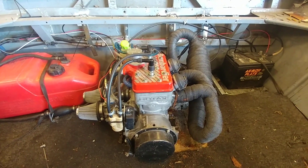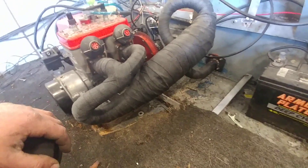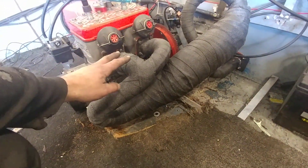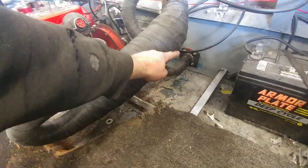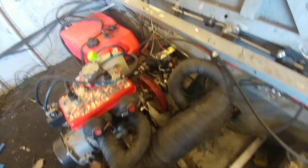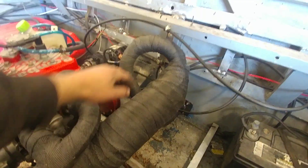I have finished the exhaust. This is the pipe I made — it's kind of funny looking but it's gonna be very functional. We've got two inches here, it brings out to five inches here, and tapers two inches and three-quarters all the way out. I made a little exhaust tip to keep the water from back-flushing up in there — kind of like a trap.